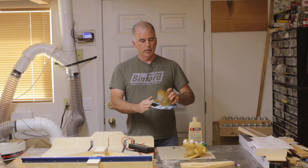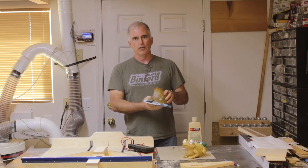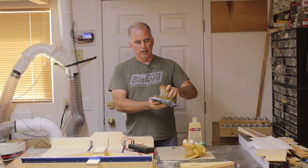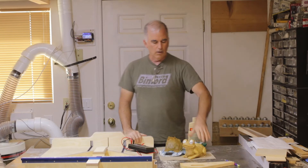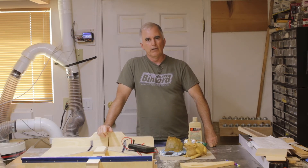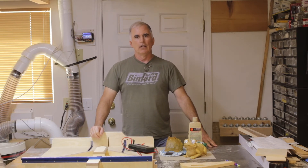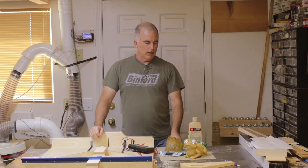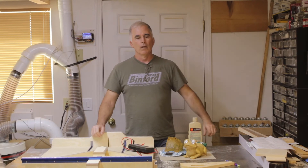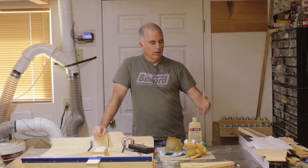When you're done repairing and it's working again, be sure to use silicone and seal it up. I used white on the bottom because nobody could see it, but I'd use clear silicone and not too much. I went all around the solar panels so no water can get in. You'll want to check the battery, the switch — if water gets in, the switch is usually one of the first things to go bad — and then wires breaking off. Besides the one that was completely rusted, usually the circuit board and LED are fine, and the solar panel has always been good on the ones I've fixed.